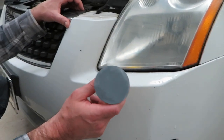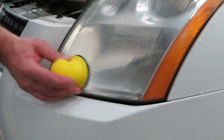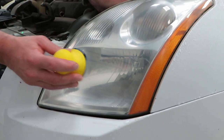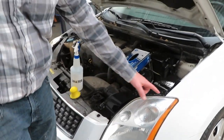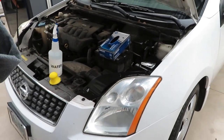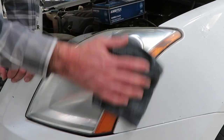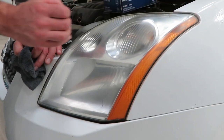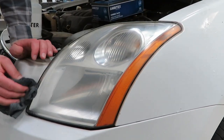Our second step: we're going to move to the 3000 grit gray pad. What we're doing here is sanding out the 2000 grit scratches, so we don't expect to see as much white haziness or milkiness running off — we're just not lifting as much material. Cerakote coating is not compatible with water, so we're going to do a really good job drying this. We need to get into the cracks and get all of this dry, because when we hit the headlight with the final step three ceramic wipe, we do not want any water contact. If you have access to compressed air, it's good to blow air into these channels to push all the moisture out. You can also just let it sit and air dry.